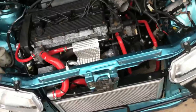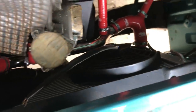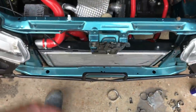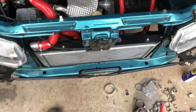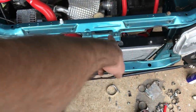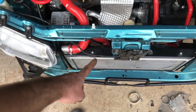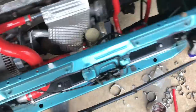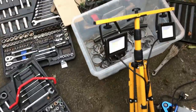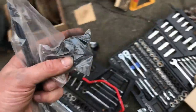The intercooler is back out again because I've put fans in. I've now managed to squeeze two big fans in the back with a bit of rejiggering, which was always the problem - trying to get enough clearance. The original 220 Turbos had the fans ahead of the rad pushing through, with the intercooler up high. I've put the intercooler in front of the radiator running the pipes through there, which means the fans can only go on the back. It's a bit of a squeeze but they are in.